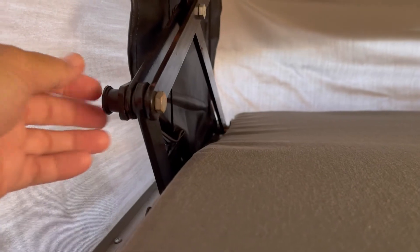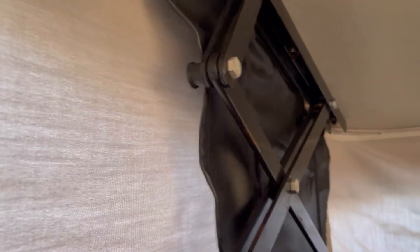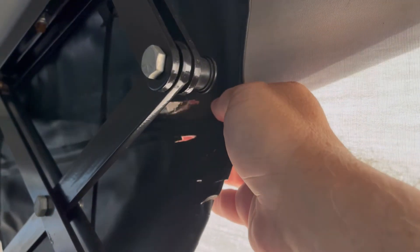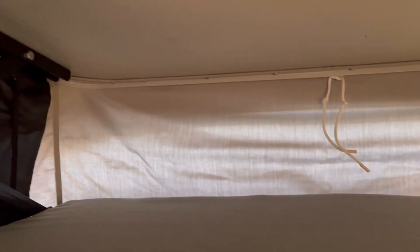For anybody that's new to these campers, it's a good time to periodically inspect up here and make sure everything's in good working order. You can lubricate these hinges for the roof. There are caps here that cover the bolt ends to keep them from ripping through the canvas - that's another reason why this panel is here. It's velcroed on the top and bottom - mine is actually coming off at the bottom - but it keeps your canvas from getting caught in the mechanism and torn. You can actually see holes from where it's gotten caught in the mechanism, so it's protecting the canvas. There's also your wiring for your roof electrical up here.